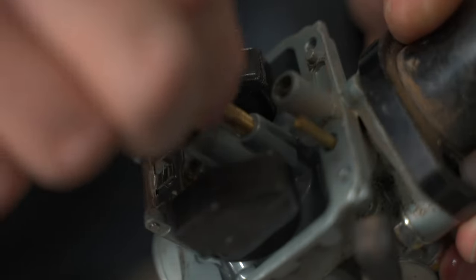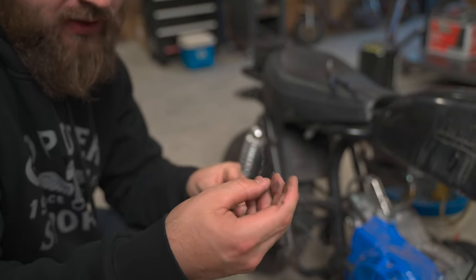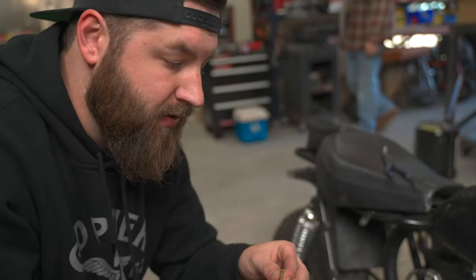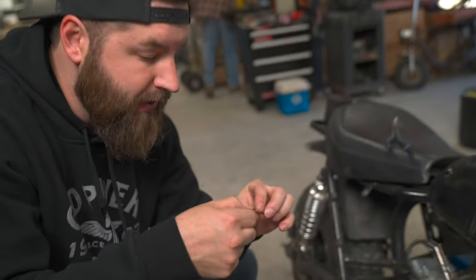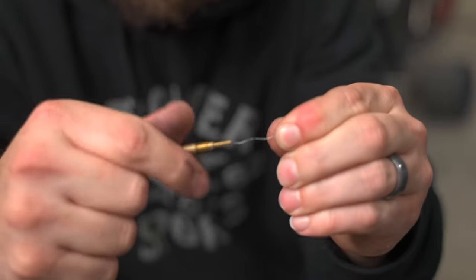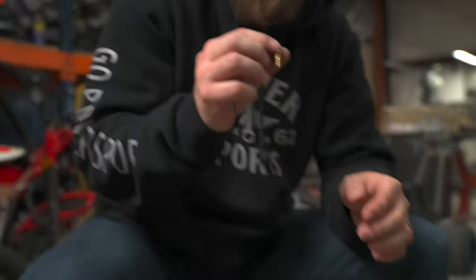Just take your flathead and unscrew it. If you don't have one already, this is just an old cable — this is actually off of a lawn mower, but you can use it as an old mini bike throttle cable or anything with the little braided wire. Unravel a little bit, and if you look off the cable, there's probably 50 little wires in there. I've been using these same two for probably 10 years. This is a perfect low speed jet cleaner — it's always smaller than every low speed jet I've ever had on any of these little carburetors. It's perfect for poking in and cleaning the main or the low speed jet. Run it back and forth a little bit, spin it around — there's no pressure on it. It just cleans any of the corrosion or buildup that might be in the hole. Then go back with a little bit of cleaner and spray it. You can hold it up to the sun or a light and look — the hole is going to be really, really small, but if you can see light through it, it should be fine.